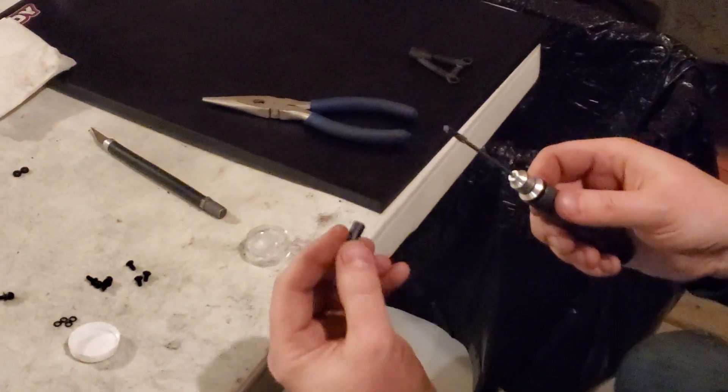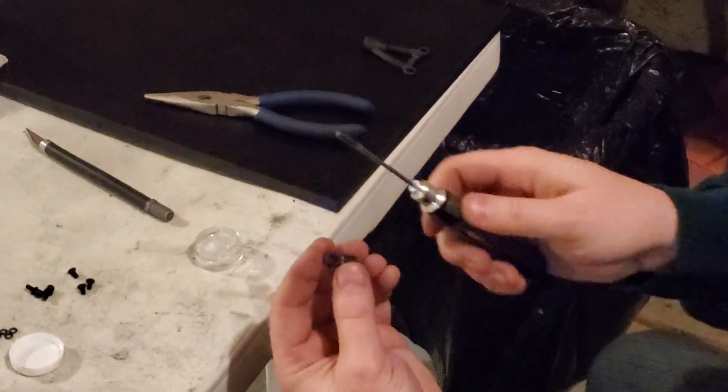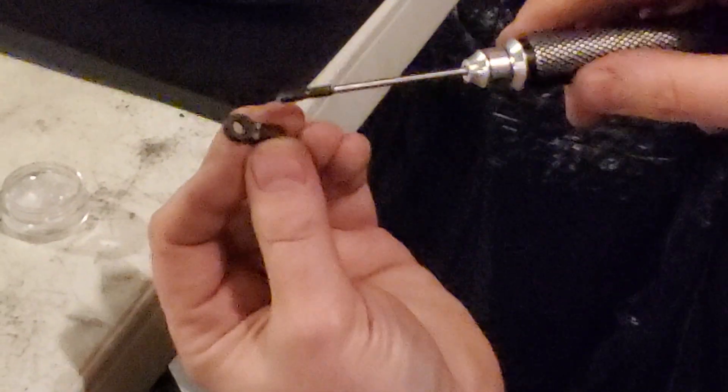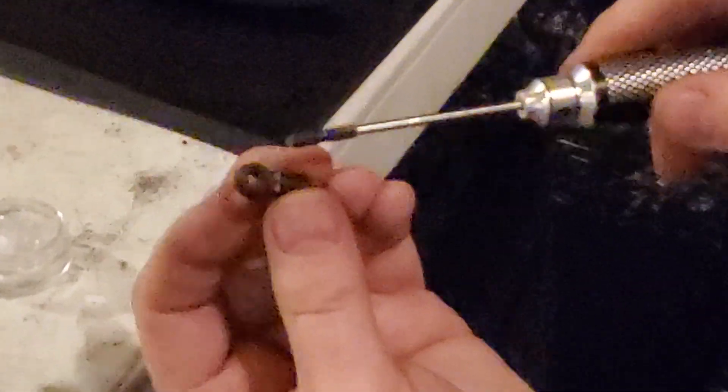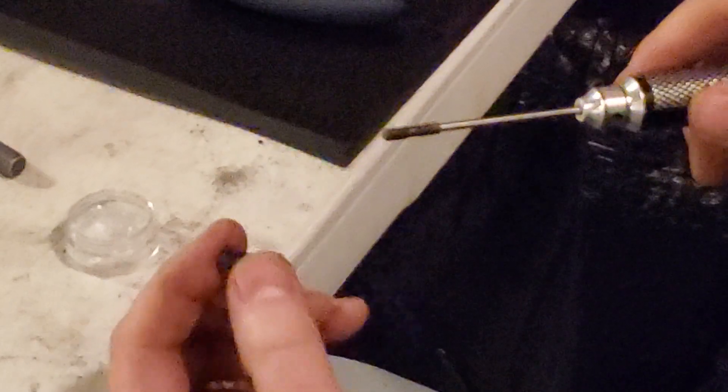They're all lubed up now. I'm going to take one of these guys, and the problem with these is that when you go in, if you don't stop, this end will just pop right off — just willingly, super willingly. Also, the other thing to note: there's a dot on the side that needs to be the top, and no dot on the bottom. The dot's on top because the hole on the bottom is bigger to fall over the ball cup when you assemble it.